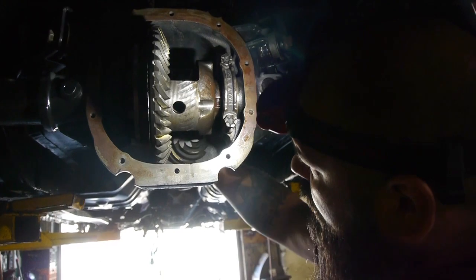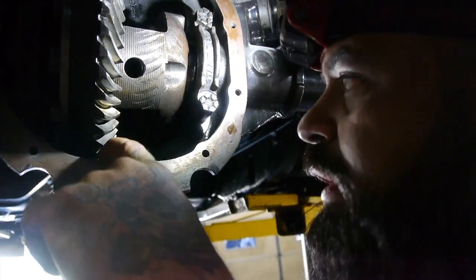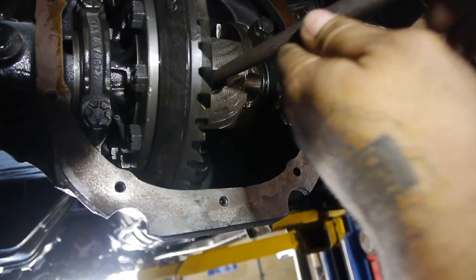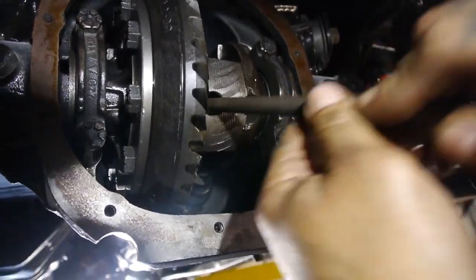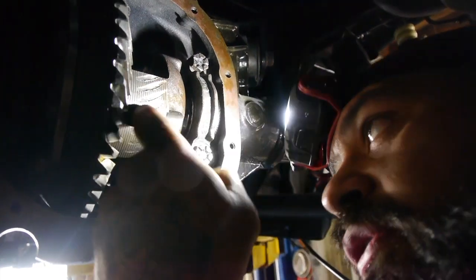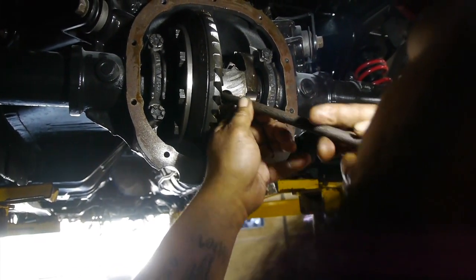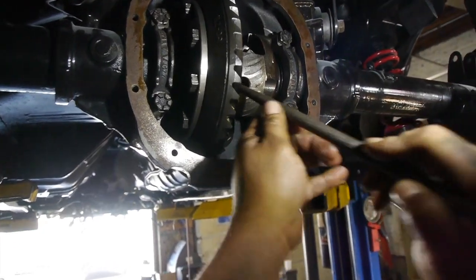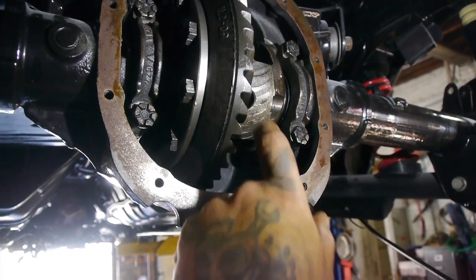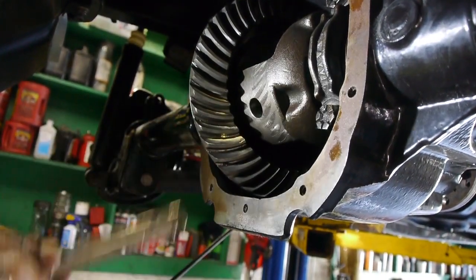Something I gotta do first. They were rubbing it around over there at Tyler's place, and they marred this guy up. So we changed these ring gear and pinion out. I'm gonna clean this up right here because it binds up in there. Make sure it slides in and out nice and smooth as it should. No binding. All right, perfect on this side.